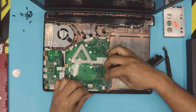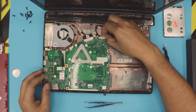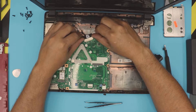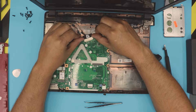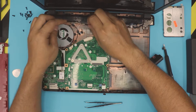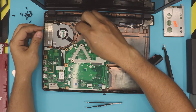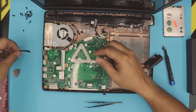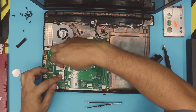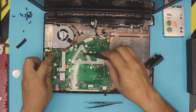Go ahead and remove the battery connector by pulling the jack backward. Remove the LCD cable — hold it from the corners and pull it evenly in the same direction backward, don't pull it sideways. Remove the fan connector by pulling it out. Remove the black tape — you may have to discard it as it won't be sticky anymore. Remove the Wi-Fi antenna by pulling it upward toward the ceiling.